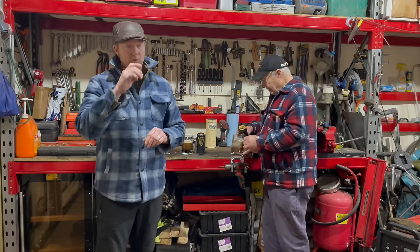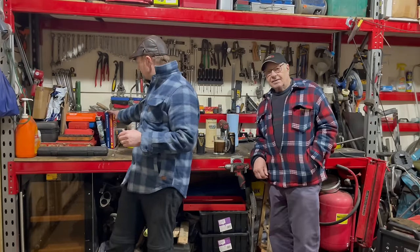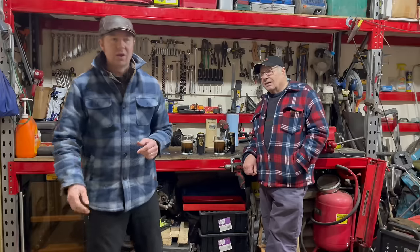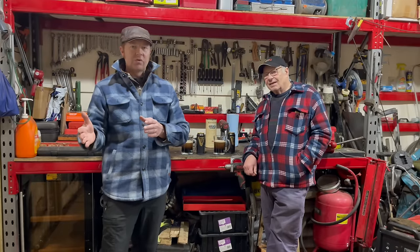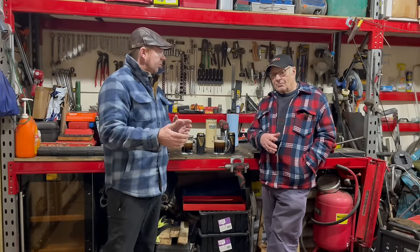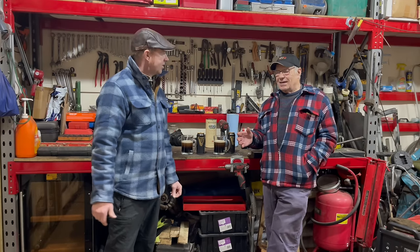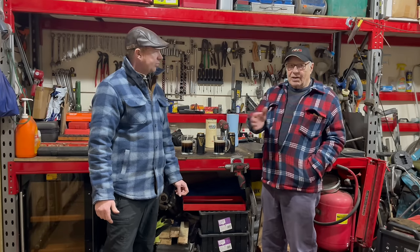People were saying about the firing order. We knew this, we're just obviously handy, we've got a Haynes manual and the repair operations manual as well. The firing order runs from the back of the engine forward instead of the front of the engine back. Yeah, that's something I always thought, they always run from the front to the back. I haven't had a lot to do with the XK engines. They're coming from the back, forward.